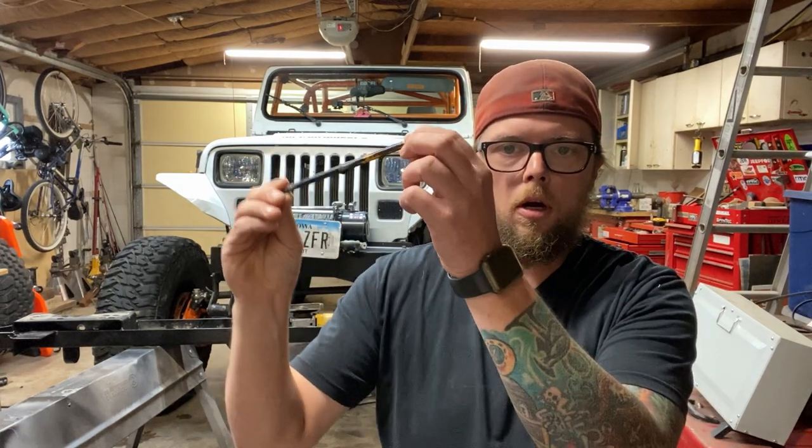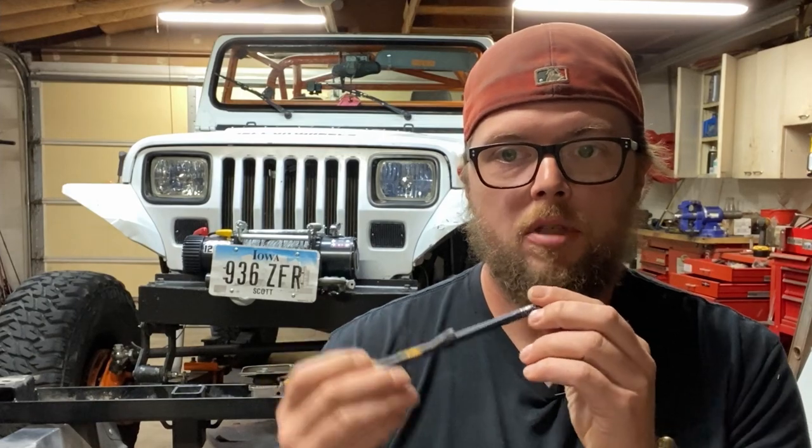Anyway, moving forward, let's get down to the pros and cons of removing your track bars from your YJ. And I say, let's start with the pros. All right, so pro number one, you will gain more flex or suspension travel. Like I said before, the track bars must move on an arc when your axle moves up and down. And since leaf springs don't easily move laterally to the side, it creates a major source of binding. Your leaf springs will keep the axle centered under the frame on their own, which actually fights against that arc movement that I was talking about. So the result of removing that track bar is you also remove that binding, which frees up your suspension to get full travel potential.